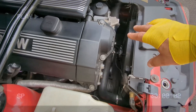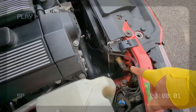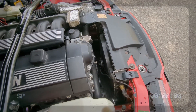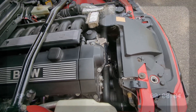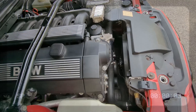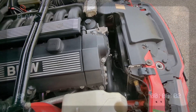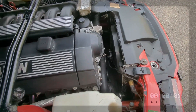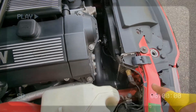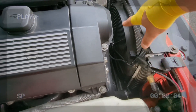I actually tried this briefly. I removed the old clutch fan, bought the switch with the lower temperature setting, and ran it through last summer. I noticed that even though it wasn't overheating, when it was getting hot in traffic at a light the temperature was really creeping up - 100 degrees, even over 100 - and before the fan kicks in it takes a long time. The way I run the car pretty hard sometimes in summertime, this was a no-go for me. I had already switched to a lower 80-degree thermostat and didn't want the temperature to go over around 95 degrees even in traffic.